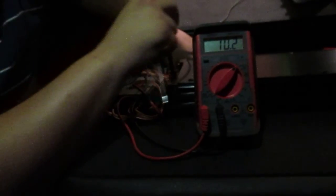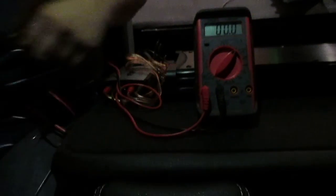Now, you're probably wondering, well, there's 2 wires going to the factory amp for the subs, because there's 2 voice coils, and the factory runs 2 different lines to each. Each voice coil gets their own channel, pretty much, out of the stock amp. So in my case, because I don't want to blow it up, I ran them in series, right? They're 2 ohm voice coils. I ran them in series, which means you'll have one wire hooked to the positive of one speaker coil. The negative of that speaker coil is going to connect to the positive of the second coil, and then the negative of the second coil is going to go to the amp. So the positive of one coil will go to the amp.